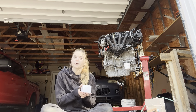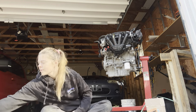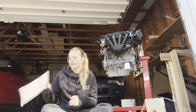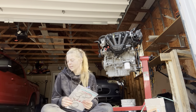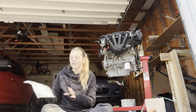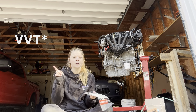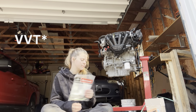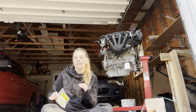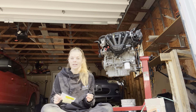New bolts because we are going to be using the crank from the 2.0-liter, so I have a new crank bolt as well as the washer to go with it. We have intake manifold gaskets because we're going to be swapping those. The pigtail — I believe this is for the PCV. I will have links to everything I purchased in the description.